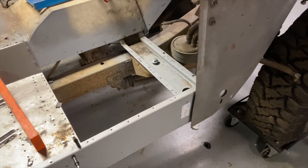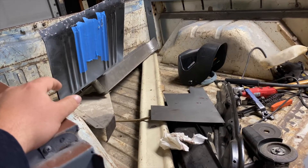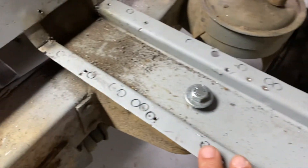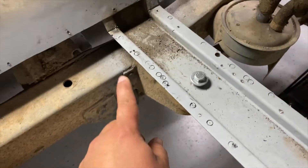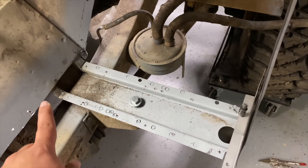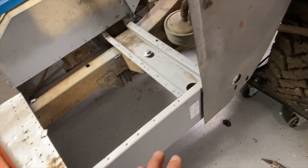So that's my big issue. I got that bolt down tight. If that pan was in there, it'd give it some structure, but I don't know if that pan is good or not. I'm still leaning toward cleaning these welds off, getting this level, and welding it better, because it moves right there. I may have to jack something up underneath here, get this level with a jack under it, put my pan in, and check my measurement. If everything works out, then maybe start welding in.